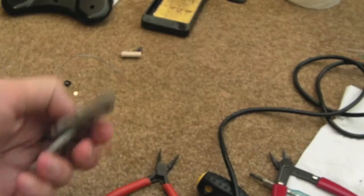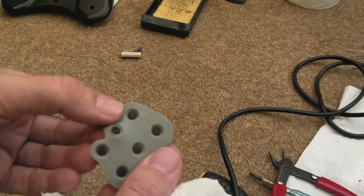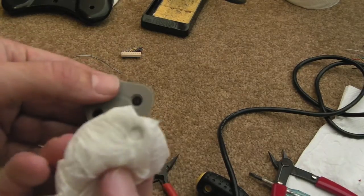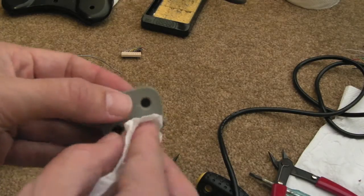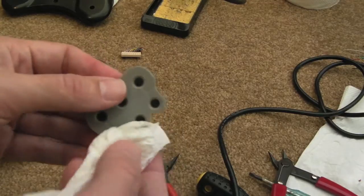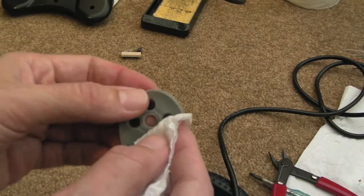The rubber parts for the carbon pads — you want to inspect these and make sure the rubber is still okay. Sometimes these buttons can come off on one side; you can perhaps melt it back on or glue it back on. Just give them a really light rub and you'll see a little bit of stuff comes off — that's fine, it's carbon. You don't want to wipe it all off, just a light rub to even the surface more than anything, and get any particles off that might be sitting there. If you're getting more than a tiny amount on your cloth, you're doing it too hard — it's just a really light touch with a damp cloth. Do that on all of them.